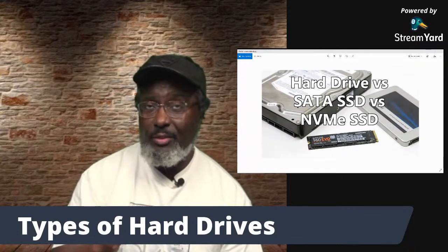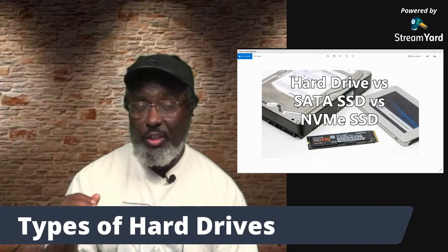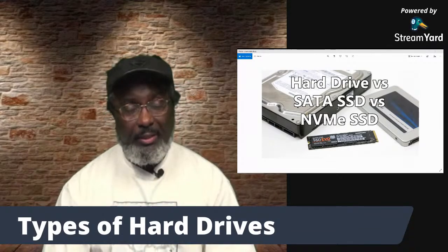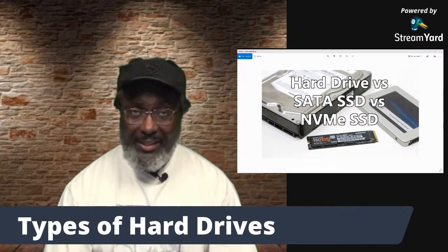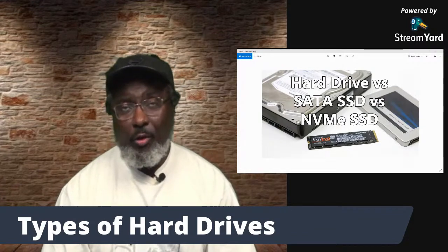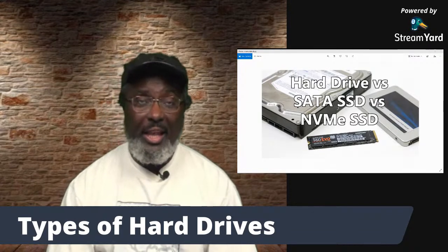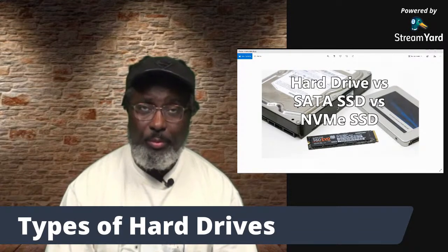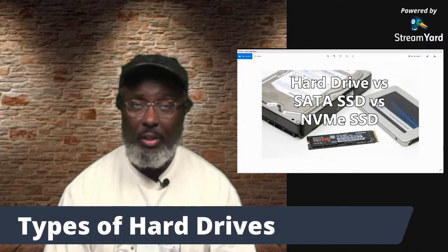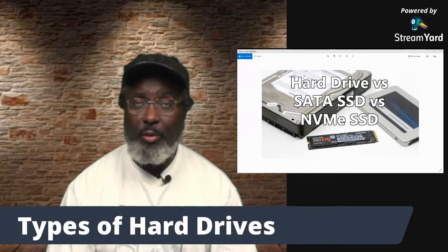With the late 2012 and the 13s, the first generation Retinas, you can only update the storage. And like I said, the storage was proprietary. It has the NVMe. So you had to get it through Apple, which means you had to let Apple do the work. Apple will charge in order to install it. I don't think they can actually just sell it or show it to you.